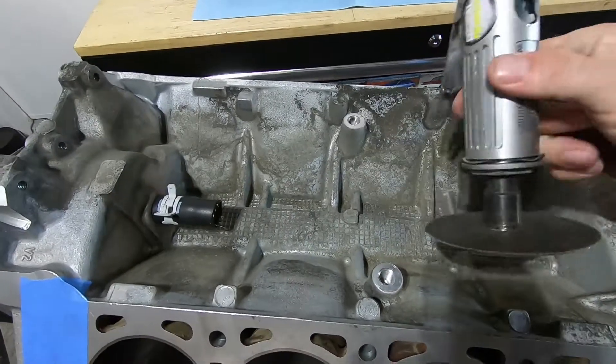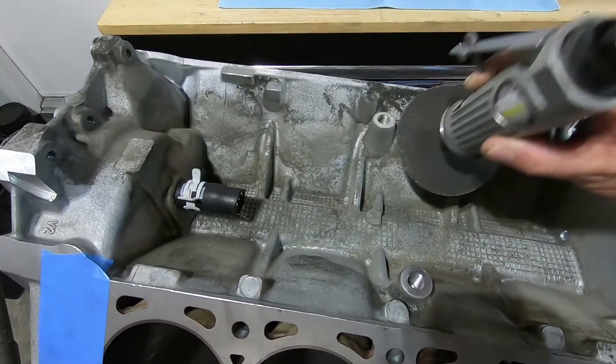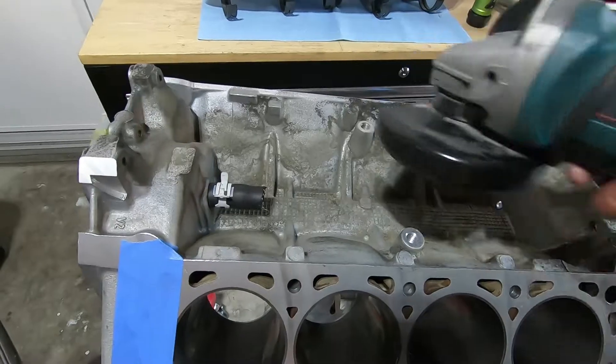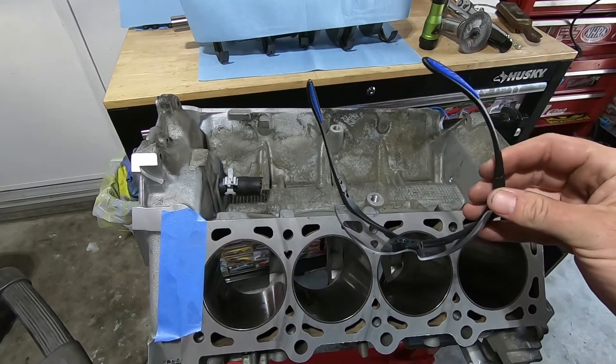To cut these bungs down, I'm going to first come across here with this cutting wheel on both of them. Then I'm going to finish it off with an angle grinder with a metal grinding wheel — just smooth them both out and take that nub off with this. And don't forget your eye protection. You might want to use ear protection as well.